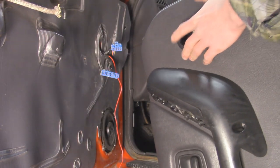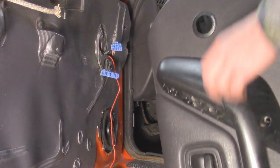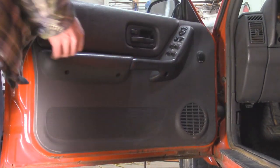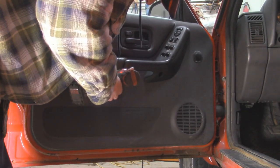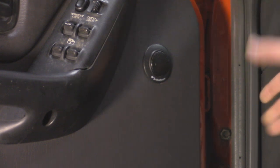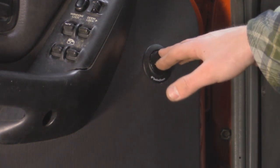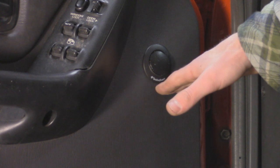Once that's in we can reinstall the door panel. Since we drilled the hole slightly larger we still have a little wiggle room, so we can rotate the tweeter and get the Rockford Fosgate logo to line up nice and level. Another trick is to install the door panel first without the tweeter attached, since it screws in from the back side — that way you're not struggling with it right in the doorway. I got it all aligned nicely off camera. Now I'm reinstalling the door panel, screwing everything back in.